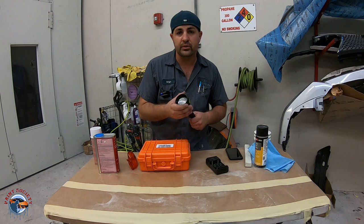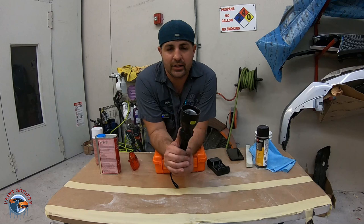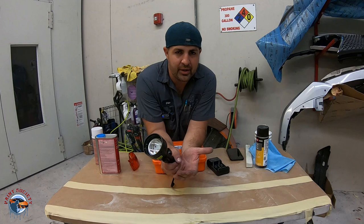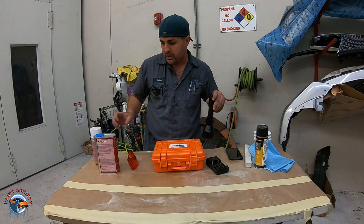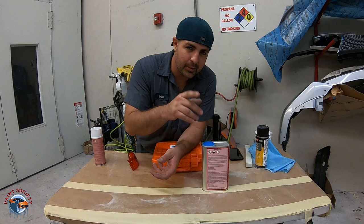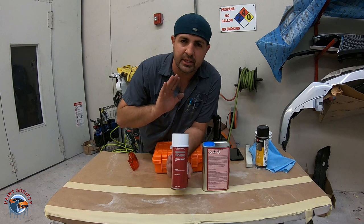A couple of key points you want to remember: you don't want to overload it. You don't want to put three or four coats on until it's dark — the light is never going to go through it. You're going to say this primer sucks. 99% of the time it's user error with anything that usually goes wrong. They wouldn't release these products if they didn't work. Keep the gun three or four inches away. Remember dinner plate — you don't want to do a whole big area with this; it's better just to use your regular urethane for that. You can spray it out of a gun — I hear you get up to seven mils with some of this stuff. Keep this out of the sun because it will dry. I've heard of guys keeping it in a lunchbox if they're demoing it and driving around town. You can still use your rattle can — you saw it there — works just as good.